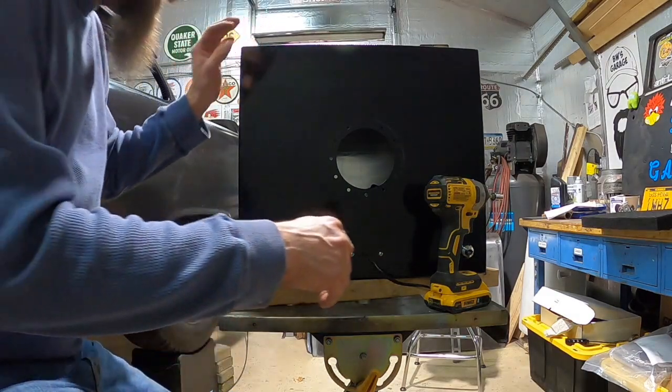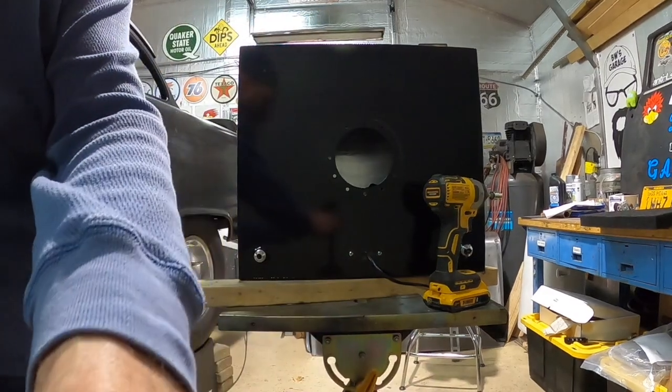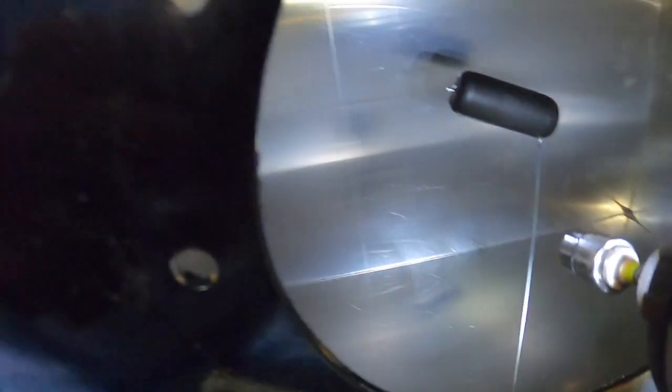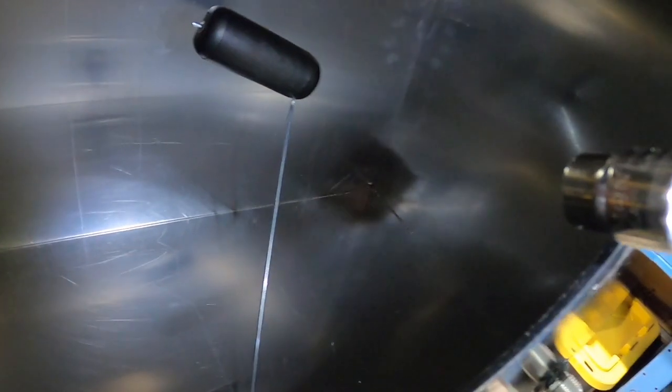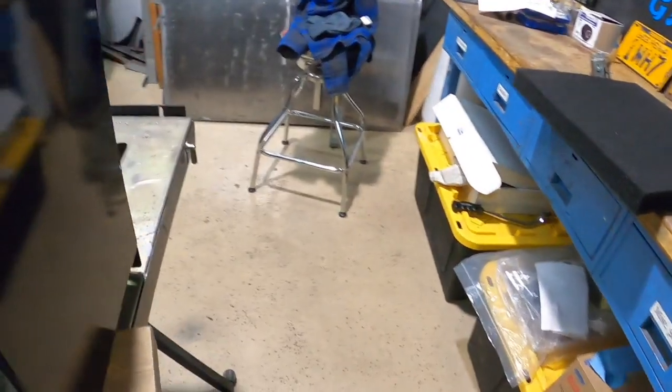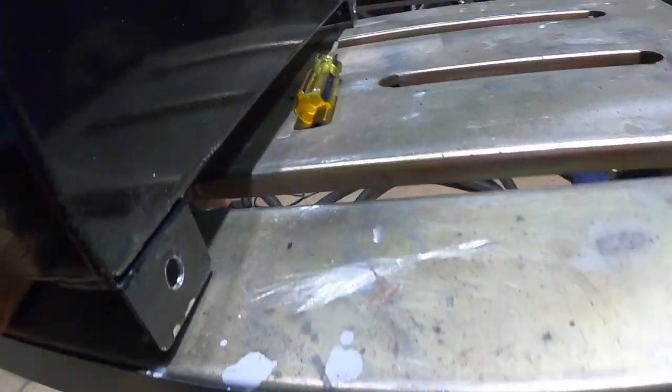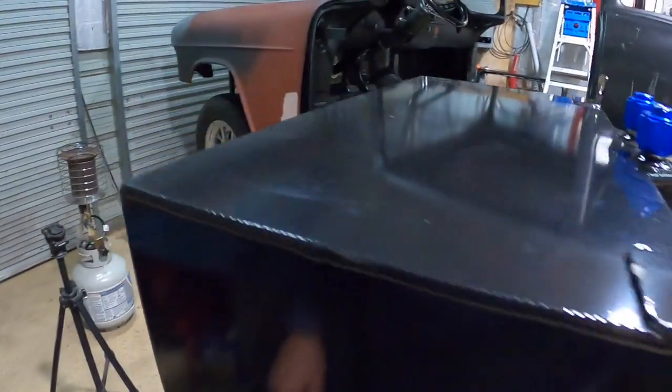The tiniest step like that could save you so much heartache over the course of time. We got all the stuff out. There's a little bit of dirty aluminum weld down in that corner — that's not dirt, that's just a little bit of burn-through with the aluminum weld. But as long as it doesn't leak it's all right. On the outside it looks like a pretty decent weld — looks like it just got a little hot right there. The tank's clean on the inside.